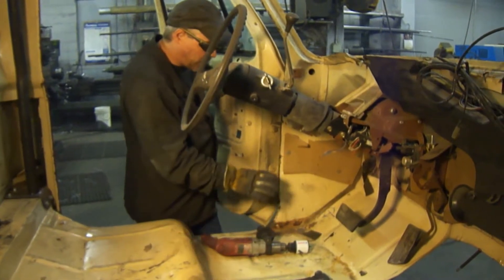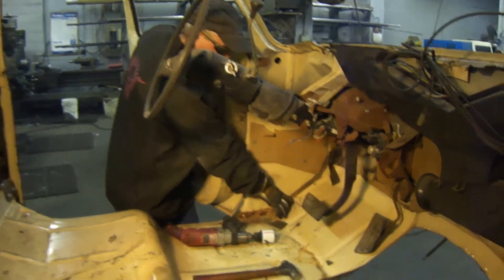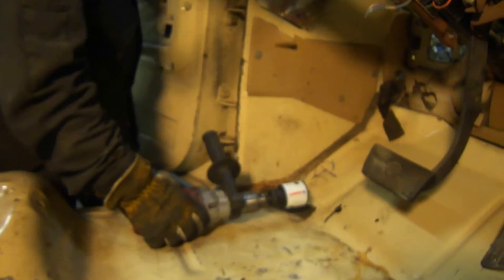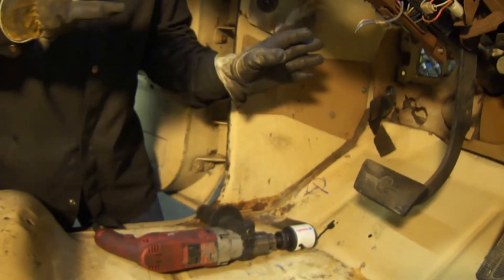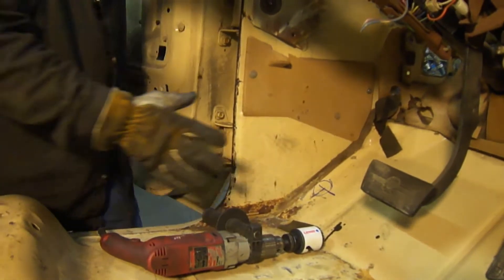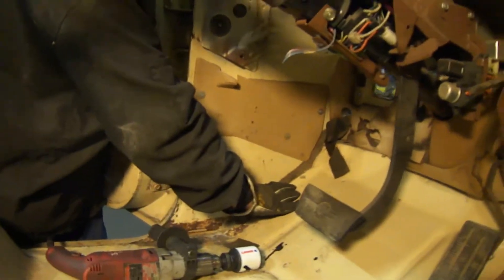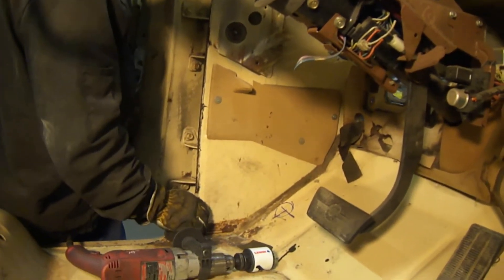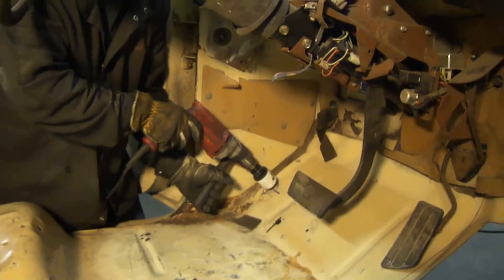Today we're putting in the A-pillar bars. We've already fitted them up and marked a center punch where our leg is going to hit the floor. What this hole is for is when you're going to weld the cage up — with a hole here you'll be able to bring the cage forward and drop it down through the floor, allowing you to get to some of the welds up on top. When it's all said and done, your floor plate will slide back up underneath the tube and cover that hole back up again. Drill this and we'll show you how that floor plate goes in.